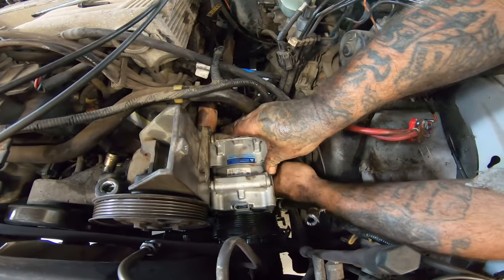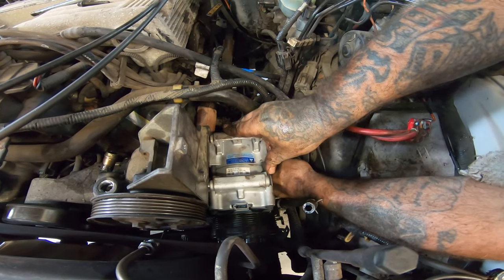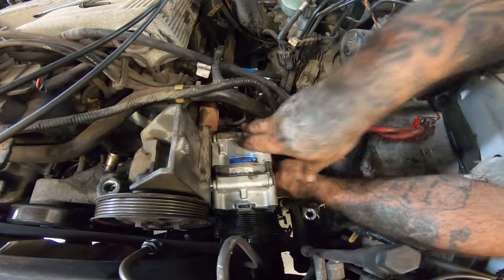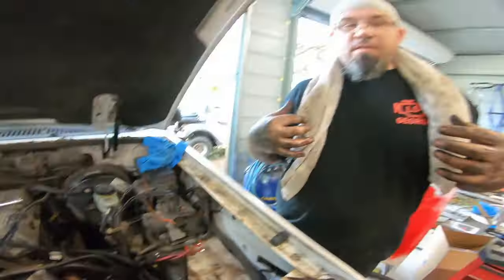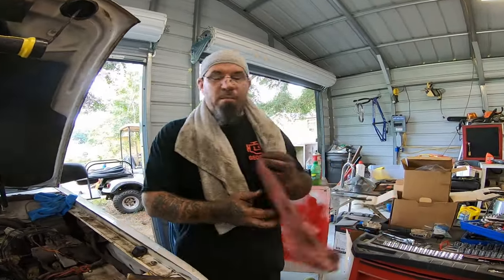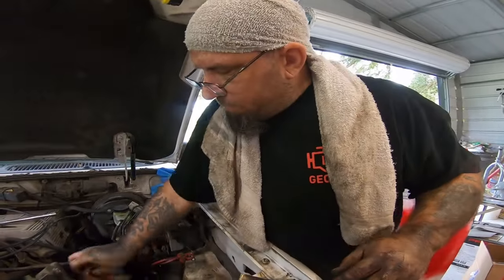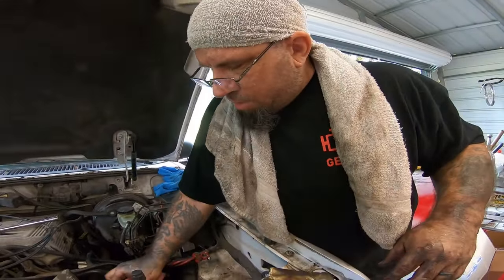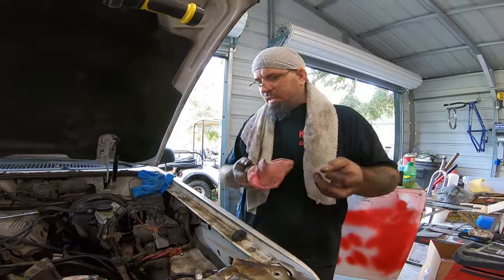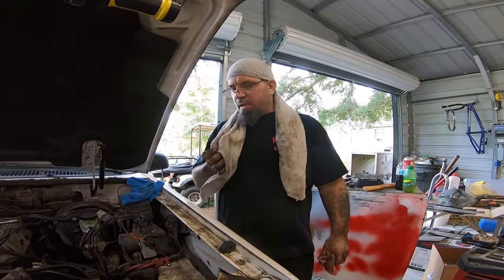Let's see. There we go. Okay, that's threaded properly. Helpful tip of the day: if you can tighten it by hand first, you can almost guarantee not to cross-thread the bolts. So, if you're unsure, put it in by hand first, and then go ahead and